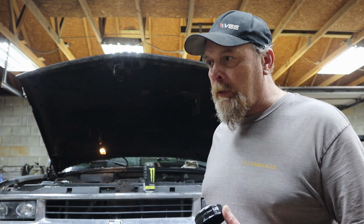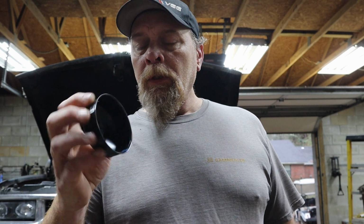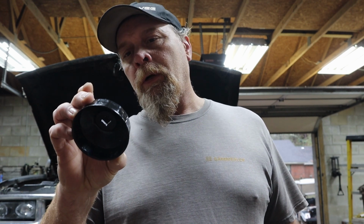Don't really have enough room to jab a screwdriver up through it and turn it that way, because of the way the oil filter comes off the side of the oil filter adapter. The driveshaft and all that stuff's in the way down there. Went back to the auto parts store and bought one of these little sheet metal looking sockets that I tested on a filter in the store, and bought a new filter also. Felt good. Brought it back home.